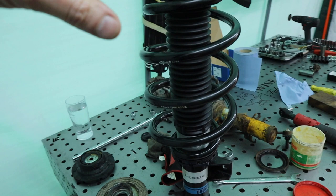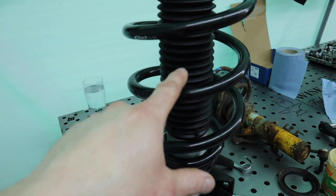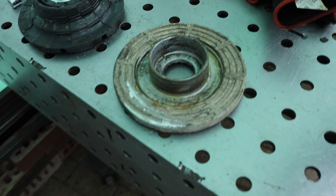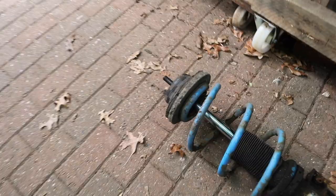A few people noticed, and on the order of building the suspension strut up, you've obviously got your adjuster at the bottom, you've got your spring, you've got your dust cover — all the same as in the video. Then you've got your top bearing race here for what the dust cover clips into, the same as in the video, but I didn't show adding these. These are off the original suspension that was removed.